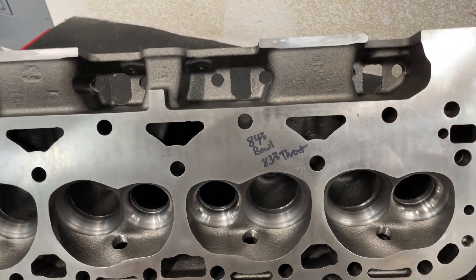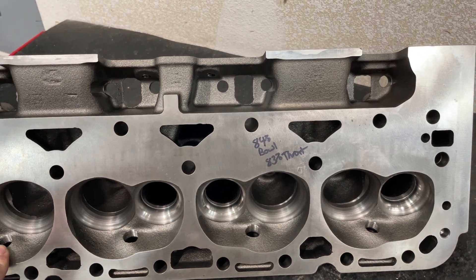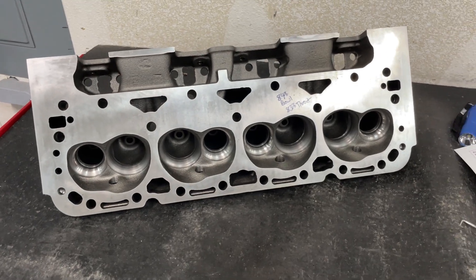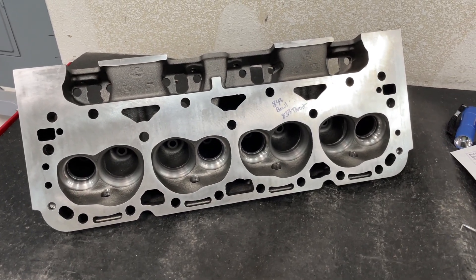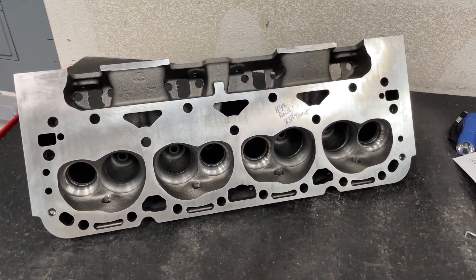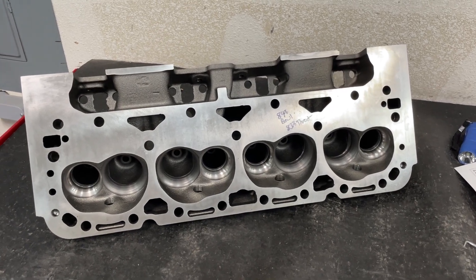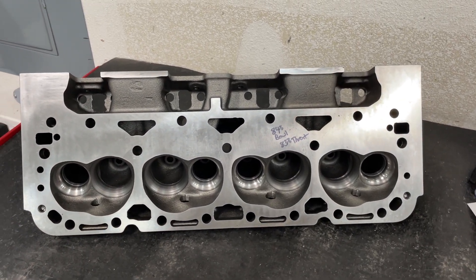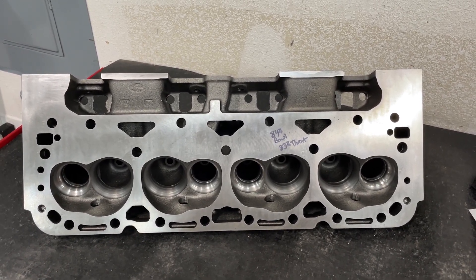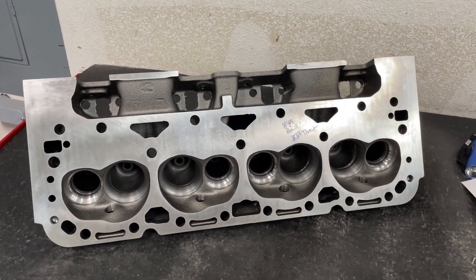This is the legal head for the USRA BMOD engines. For those unfamiliar, if you've been paying attention to my channel — there's a class, circle track racing on dirt, it's an amazing class called BMOD. It looks like a modified, except they have weird engine rules: you have to run a certain type of head. You can run a stock head, certain ones. You can't run Vortec, you can't run double humps. You have to run these really bad heads, or you can run aftermarket heads like these.